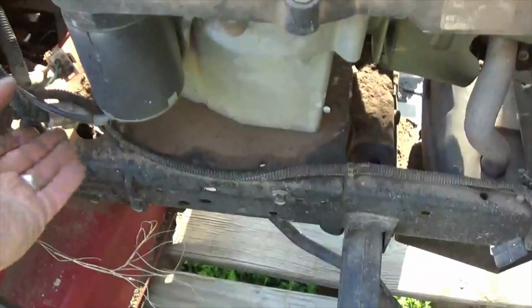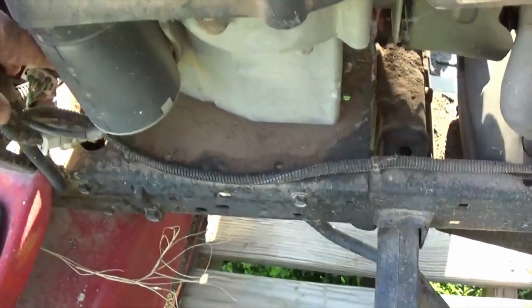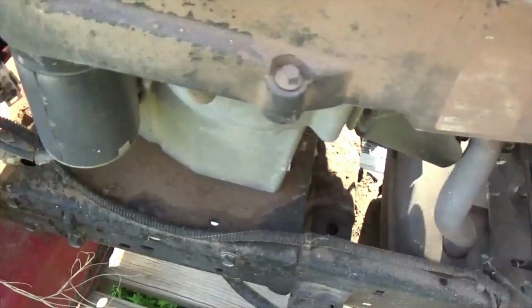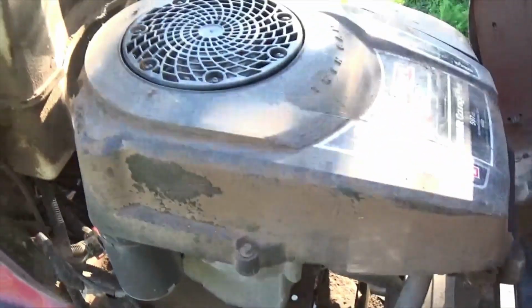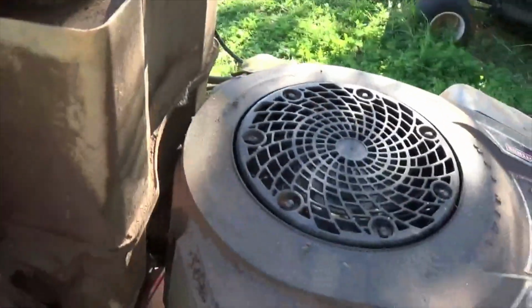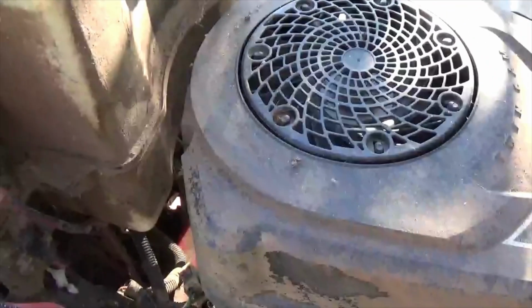I'm hoping that maybe I can just unplug the motor and plug the other one in, after doing some wrench turning on it too. But hopefully the plugs will just match right up and be good to go. I'll have to make sure there's no old gas in here. Get that all flushed out. Yeah, there's a little bit in there, so I'll have to do a little flushing.